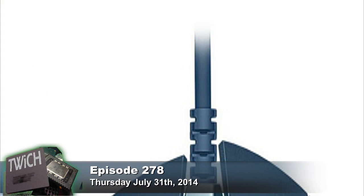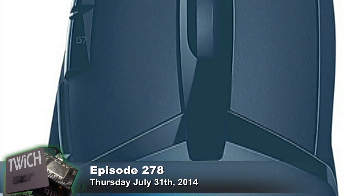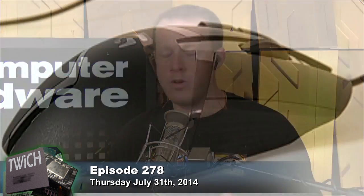But the real interesting part about this is that it has what they are calling a fusion engine in it, which is a fancy marketing term for what they've actually done: they've supplemented the standard optical sensor. So it's just an optical mouse, right? The G402 is what we're looking at. If you know how optical mice work, the optics sensor is actually just taking pictures at 1,000 times a second or something like that, and it compares those pictures to each other to figure out how far you've moved and in what direction.